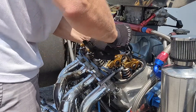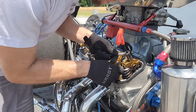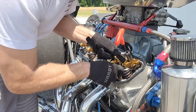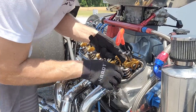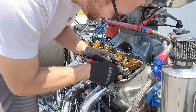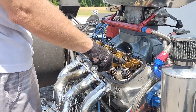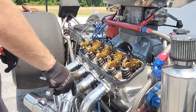When you go to lock it down, know that it will get a little bit tighter as you snug it in place. So you don't want to set it too tight initially — when you crank it down it'll be even tighter. Set it right there, then check it again — good and snug. That one's done. Now I'm going to bring this around until the intake starts to come up — that's the intake starting to close — and then we'll adjust the exhaust valve.